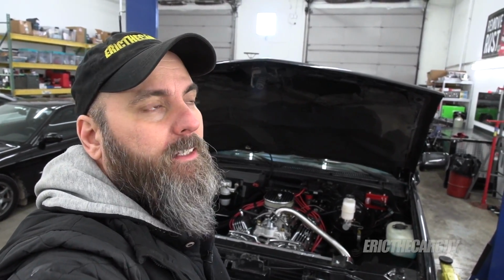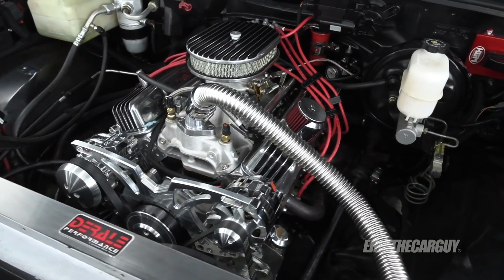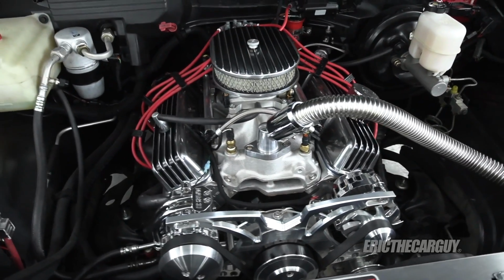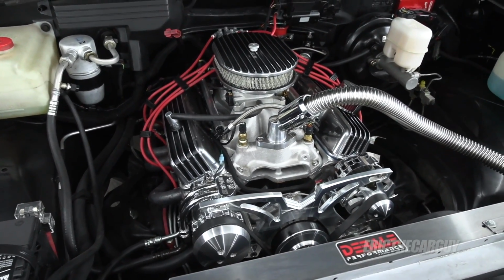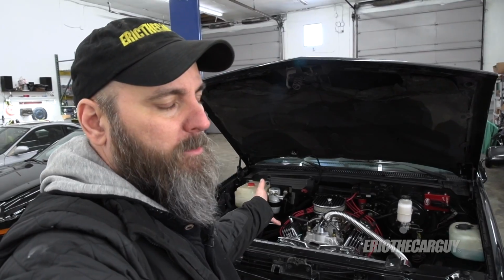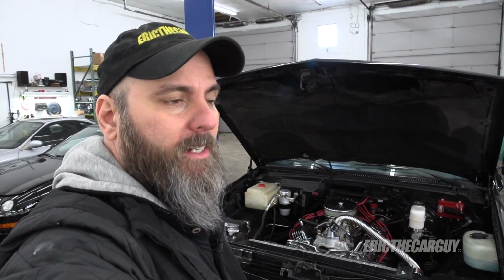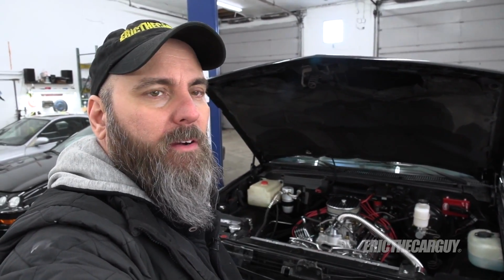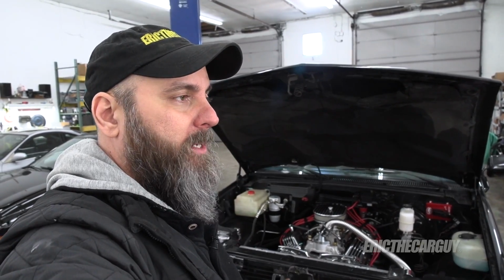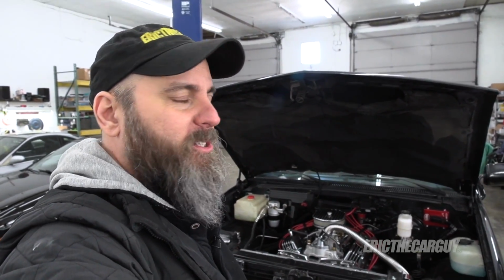Words fail me as to how exactly I'm feeling right now. Elation might come close, but man, that was a long, strange trip, to go through all that and the power tour and get it all together. And the only thing I can attribute this issue to is the compression was too high for pump gas. Because now the compression is down, I'm able to drive it, I'm able to flog it, even at 28 degrees of total timing, which, you know, probably be a good idea at some point to get this thing tuned so I can get every ounce of horsepower out of it that I can. But here I am with a running and driving truck, which doesn't blow oil everywhere. Just opening up the hood right now and not seeing oil everywhere, I've never experienced that since I built the truck. So I'm pretty happy that we're in this place.